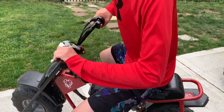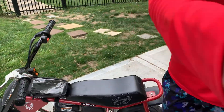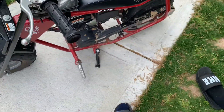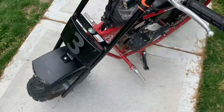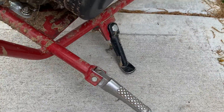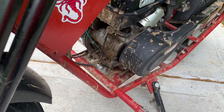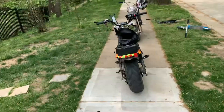That was about 28 mph — pretty good. One last thing: the kickstand spring comes off all the time. It happened at least five times to us. Just put a rubber band on it — we either tape the kickstand or put a rubber band on it. It's been holding up okay, just something you guys should know. Pretty good minibike.